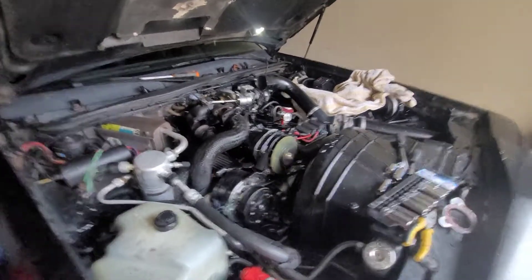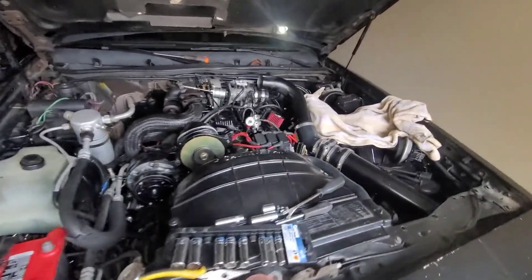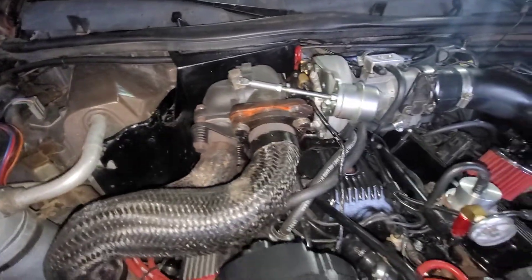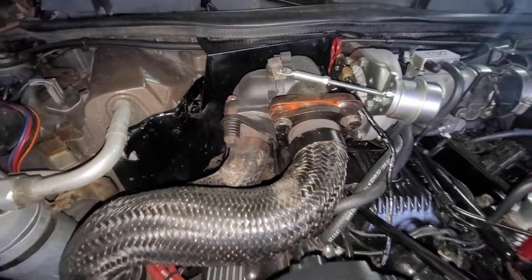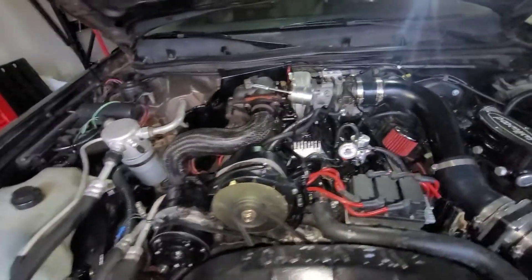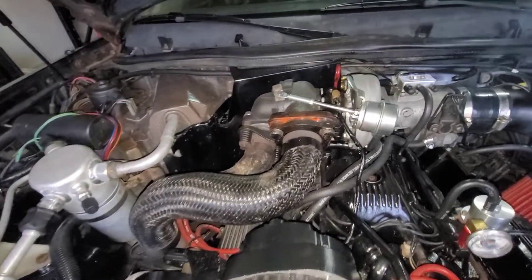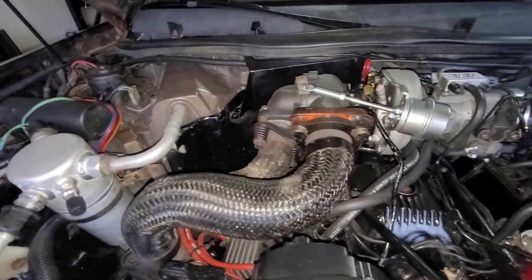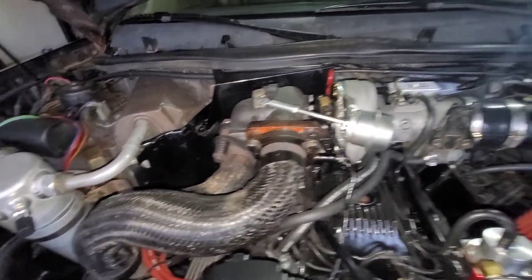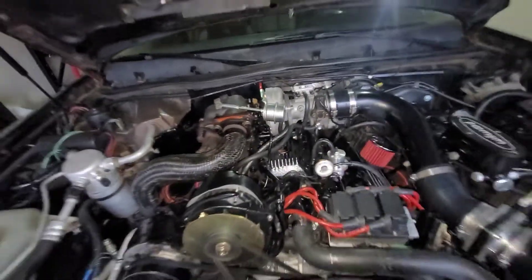That's a fire hazard with everything getting hot in there. I'm going to tighten it back up and build it all back up. I put high-temperature gasket maker on there because there was a slight exhaust leak and I wanted to make sure I shut that off, because you can lose power that way.